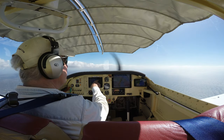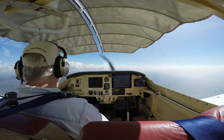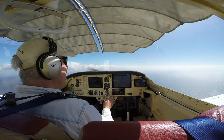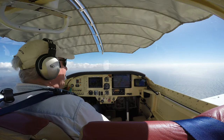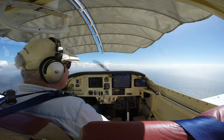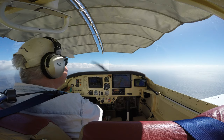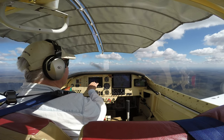I've got 2,230 RPM, a TAS of 140 knots, and a fuel burn of 24 litres per hour. There's not too many aircraft you can cruise along at 140 knots doing 24 litres an hour. We're running at 57% peak power, trimmed up for peak. The hottest CHT is 303 degrees - the engine would run at that temperature forever. Got to love an RV6. Fixed pitch prop, carburettor. 24 litres an hour, 140 knots, hands off. Now TASing 155 knots at 28 litres an hour.